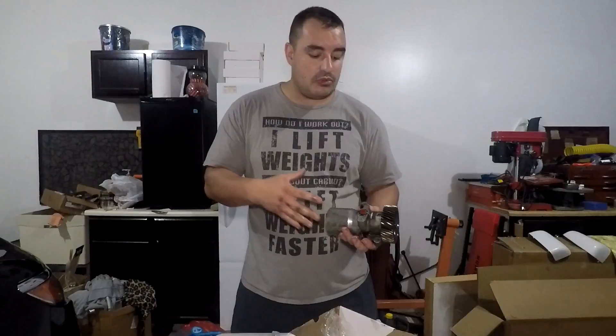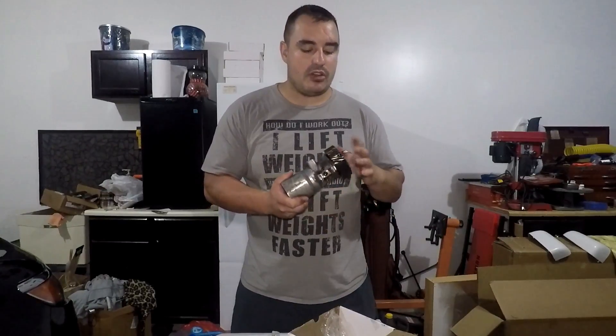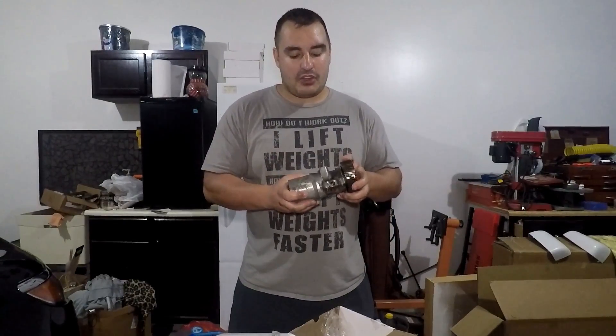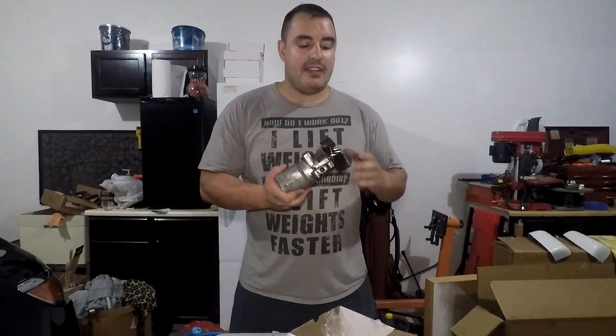I'm not talking bad about them by any means — I just went a different route. As far as the backplate wear and the fact that this isn't the really cool-looking fancy billet aluminum housing everyone's used to seeing on upgraded six liter pumps: there's actually a fix from factory. The original manufacturer of these pumps sells an updated housing that fixes the issues. Although the billet housing is awesome, I have a hard time paying for just that.